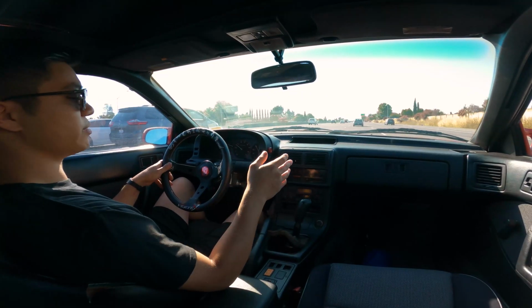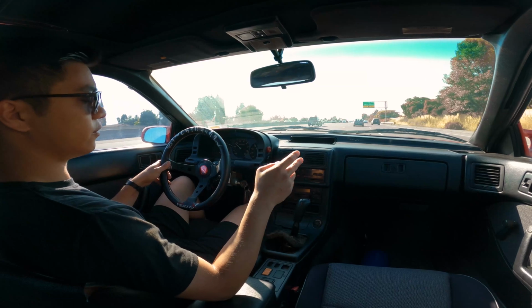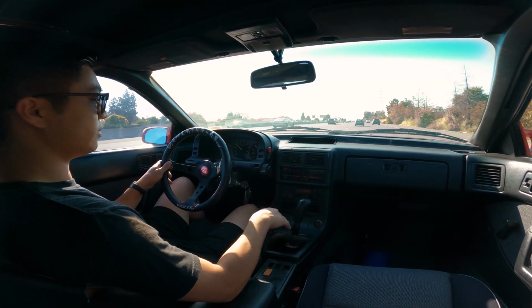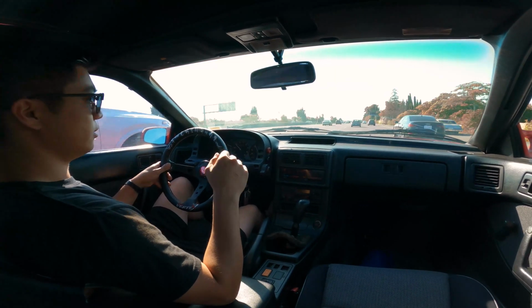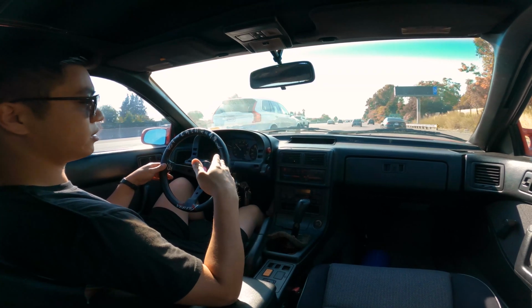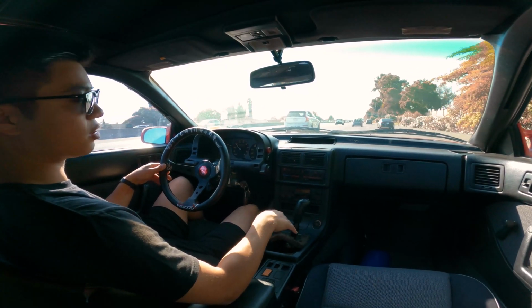One thing I did forget to mention was that although I have the Miata first, second, third, and fourth gears, I do still have an RX-7 fifth gear. So on the highway, I have a much better ratio. A Miata fifth gear is shorter than an RX-7 fifth gear, so highway RPMs are higher. But the way I did it, I kept the RX-7 fifth gear.